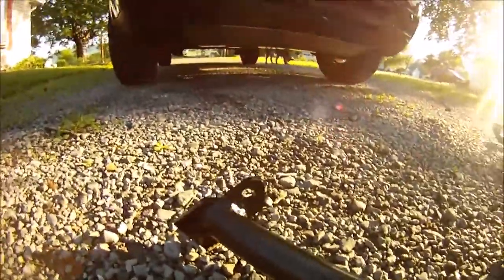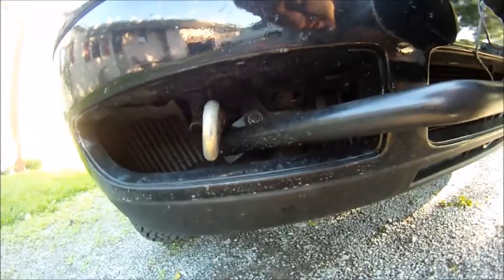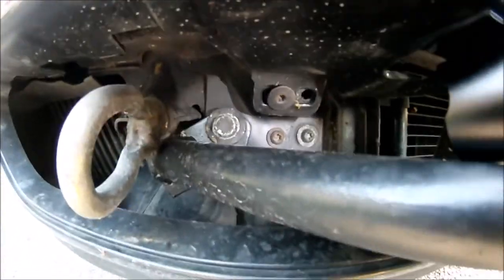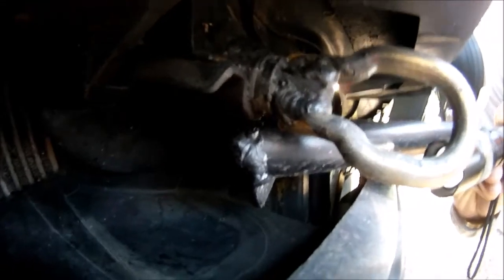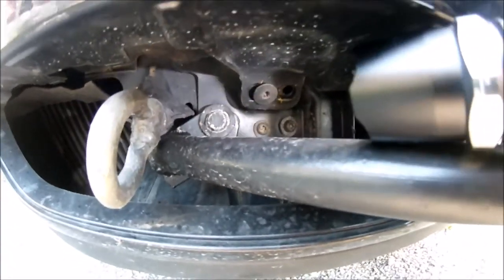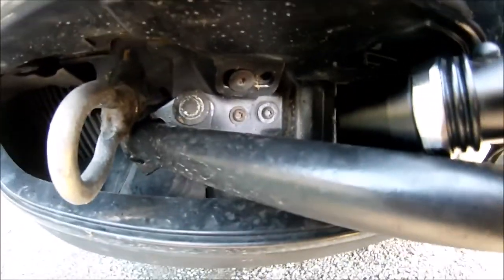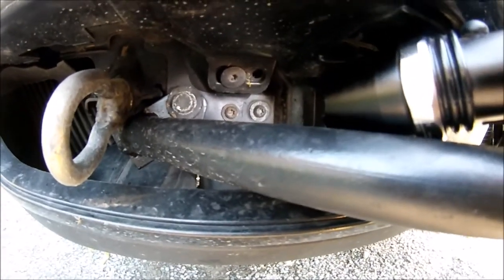Alright, so then the passenger side bolt is the easy one. It's just one hole. You can see it. It's that other side radiator support bolt, same one we use on the other side. It goes up tight against the tow hook bracket, helps hold it there, and then you just pull that bolt out and put it back in. That is the stock bolt. That little rounded, bent flange piece goes on the outside on this side, so this side's a little bit shorter.